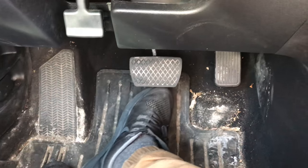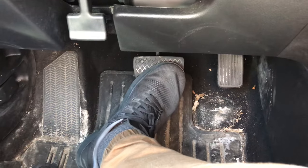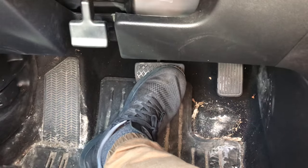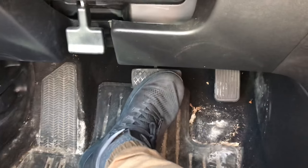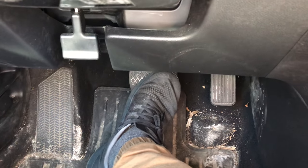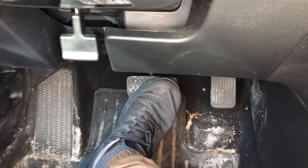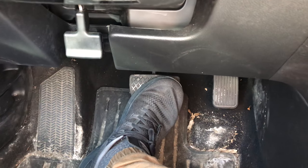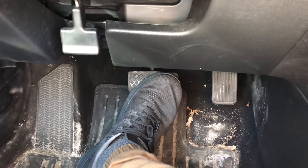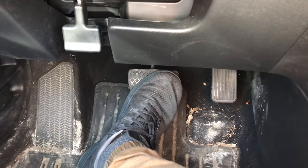What I'm going to do is take my foot and press down gently on the brake pedal — press it down, then release, press it down and release a few times. What's going to happen when you do this is it's going to be harder and harder to press that brake pedal down. Now, as you can see, it's actually really hard for me to press it down — I press down gently and I feel the resistance on that brake pedal.